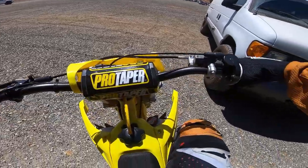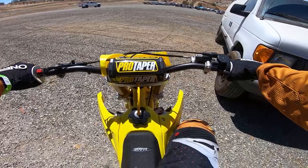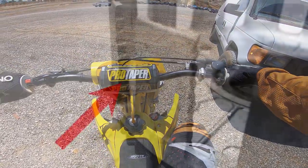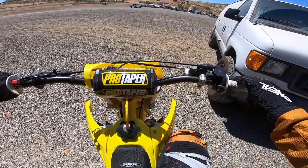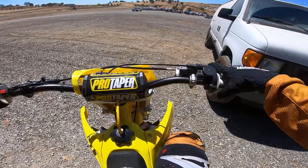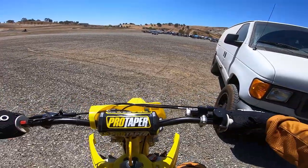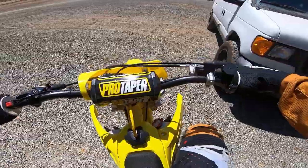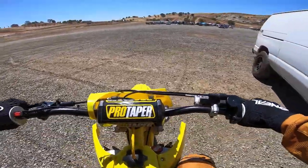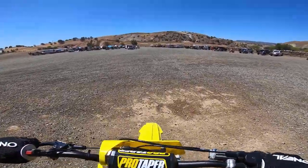I'm really excited to try this. Now listen, the bike does have a crappy clutch basket in it. It's notched, so it likes to chatter when it takes off. I won't be surprised if it does that, but listen to the engine. Normally when we have a stock carburetor and we're dealing with the bottom end takeoff, where you get a little bog, like a pilot jet air screw combo, you get sort of this choppy takeoff. A lot like the clutch basket thing actually, but let's see. All right, kind of hard to tell. You can see the clutch basket is pretty notchy.